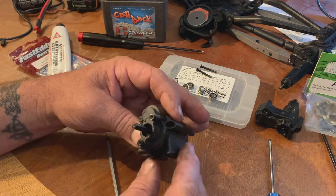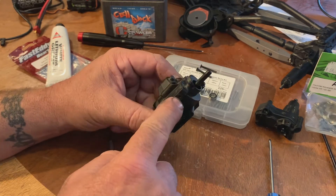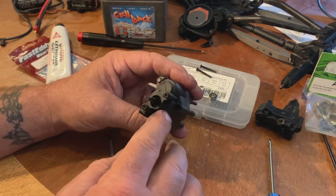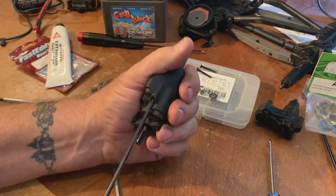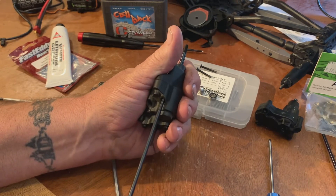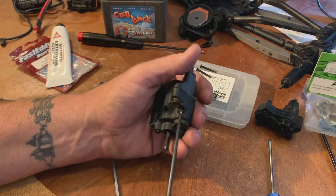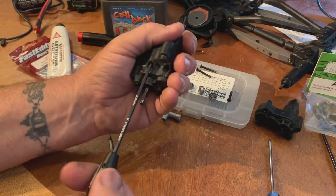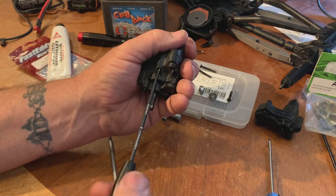On to the transmission. It's held together by four screws: one there, one there, one there, and one down here on the bottom. There's also a small screw on the side — don't forget to make sure that's back in there. When you're doing this, make sure you use good tools, because if you spin the head out on one of these screws down inside these holes you are going to be really cussing yourself. I've done it, so use a good tool — a fresh bit would be best, especially on these really deep-well screws.